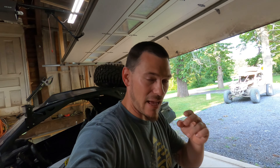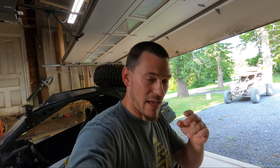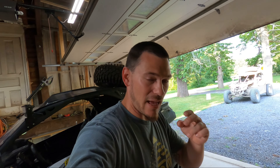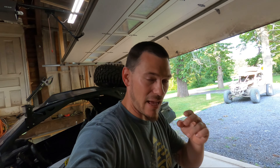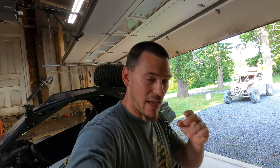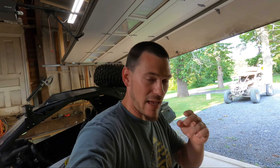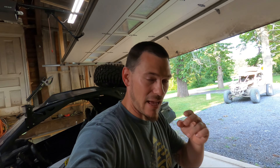You're going to have to remove the brake line off of the radius for your trailing arm. You'll also have to drill out the rivets — they give you bolts and hardware, mounts and everything to hook the stuff down to their trailing arm. Now pull the hub off. We're going to take an 18mm and take all these off, pull the hub, and then this will be free. Then take the shock and the sway bar link off — it's an 18 up there as well — then take the brake line off and we should be good to go.